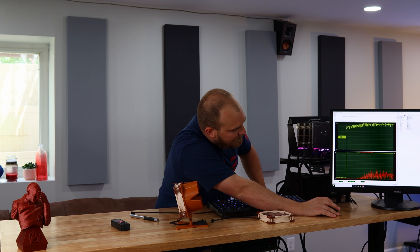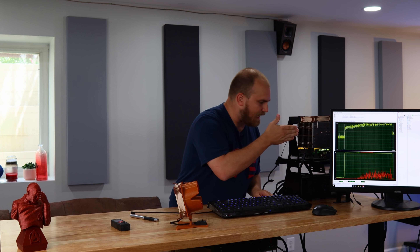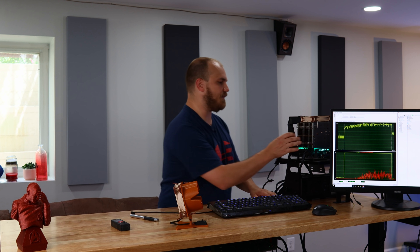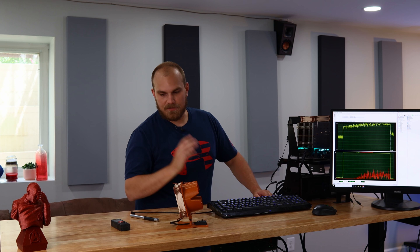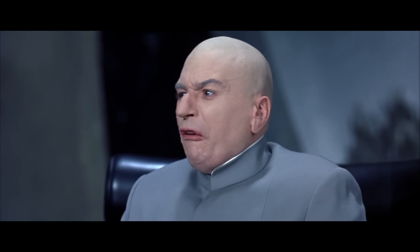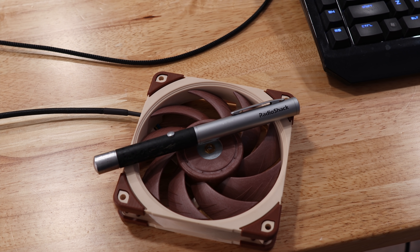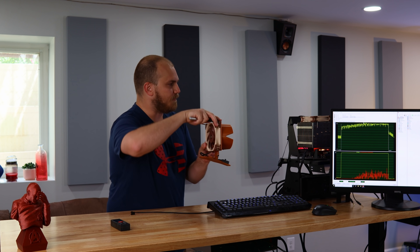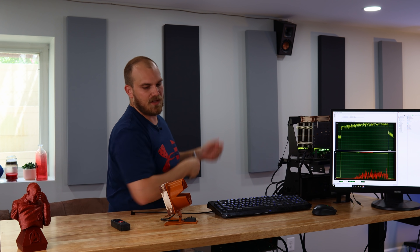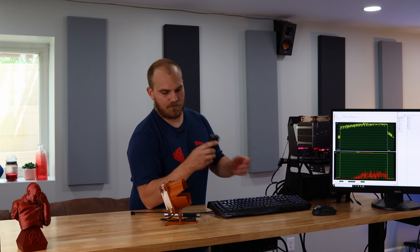In order to make sure we're properly aligned with the fin stack — and this is a good cooler for this test because the P1 is a passive air cooler with a really low fin density, so you don't need a lot of static pressure to push airflow through it — we're going to use this Radio Shack green laser I've had for a long time to make sure we're pointing the fan at the fin stack and not off to the side. To measure distance we'll use an electronic tape measure with a red laser — red and green, like Christmas.